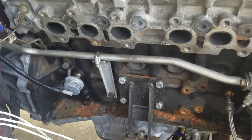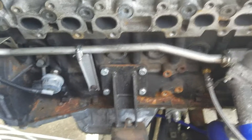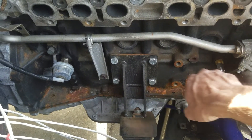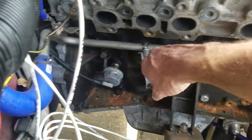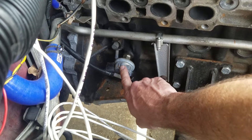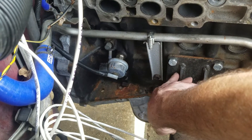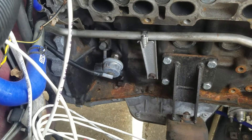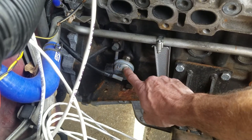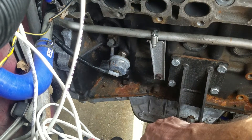While we're down here with all the exhaust out of the way, this is the perfect time to show you how to plug up the oil pressure lines that connect the two turbos. These were the supply lines before, but for this setup I've actually put the analog oil pressure sensor for the dashboard. As anyone who's messed with JZ engines knows, there's usually two sensors for everything — the computer needs one, and you need one for your own satisfaction. This was actually the 7M oil pressure gauge that's going to integrate with the analog dash meter as well.